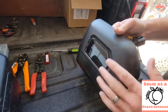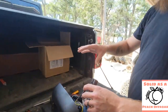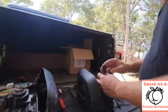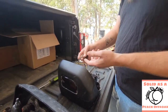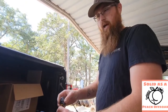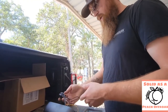As far as I know, I think that's just because we already have the LED setup. The way they have the tail lights designed from the factory, it's stealing power coming in there for the light and sending it back out to your marker light. If you have the halogens and you get these, leave some comments — tell me if you guys had any issue with that, and maybe that's something we can work out with AM in the future. That is one reason it took us a little while to do this video.